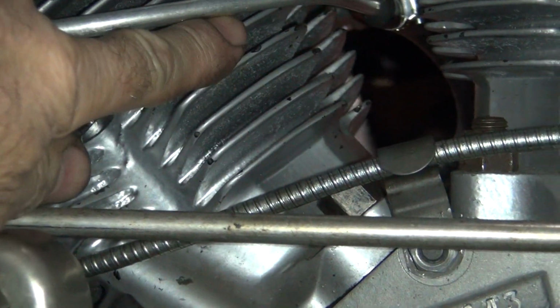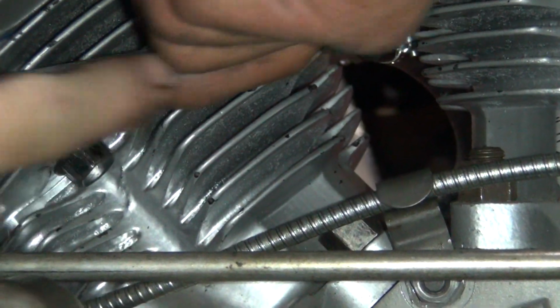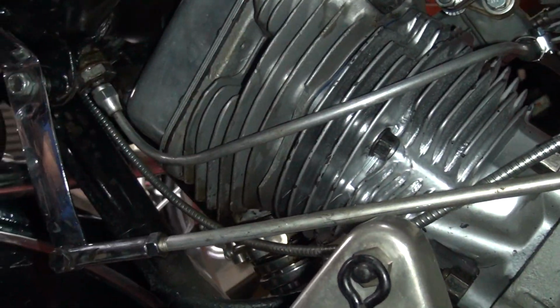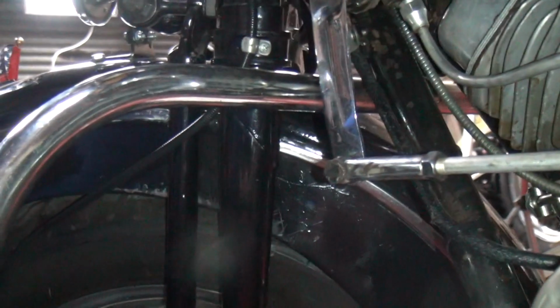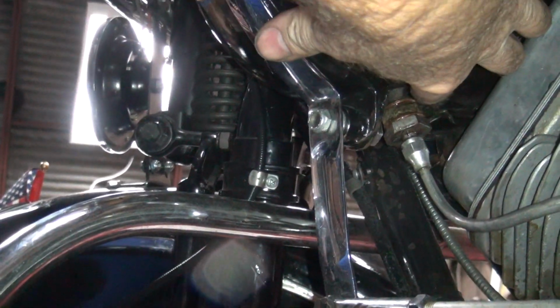There's that gas leak I smell. Where's it coming out of? Well, it's coming from up here. It's working its way out, coming from that fitting. I didn't tighten it up tight enough. Yeah, see, it's coming from there. It's going down to here. You're not leaving stuff loose again. That's that petcock that's leaking. No, it's not the petcock. It's way up. It's that seal right up there.